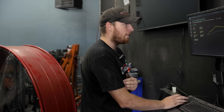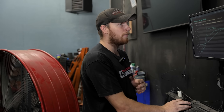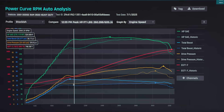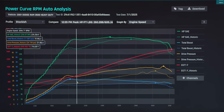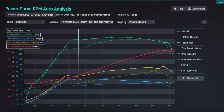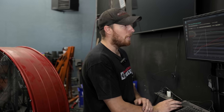Now let's go over to the actual numbers and see what exactly happened. EGTs were higher, we made more drive pressure — that kind of makes more sense. Boost was definitely higher — we peaked at 26 pounds from the 18 pounds we peaked before. Horsepower was up in the meat where it wanted the fuel, and then out top it didn't really need it and it just made it run a little bit hotter. So if this is your tow truck, maybe there's a middle point you can set it to and be happy, but ultimately this would feel good on the street but it's probably not going to tow as well — choking it down with that gate closed doesn't seem great for EGTs.